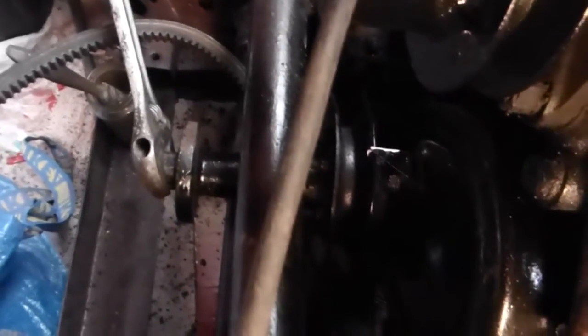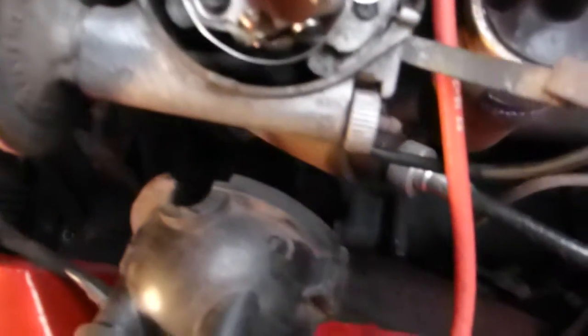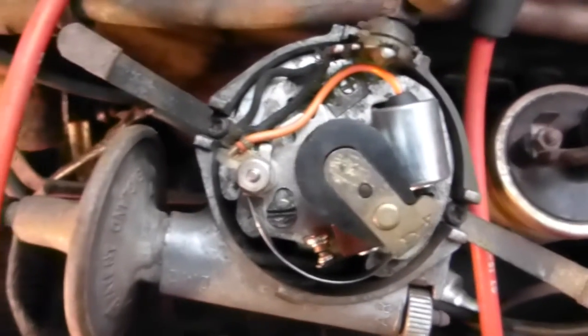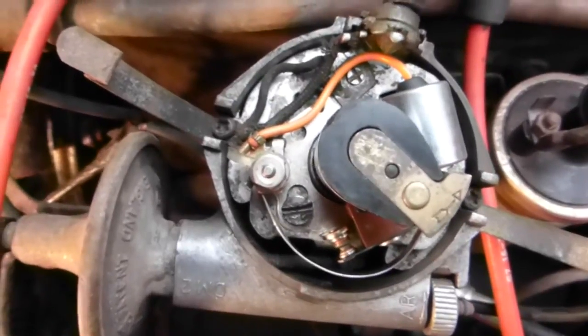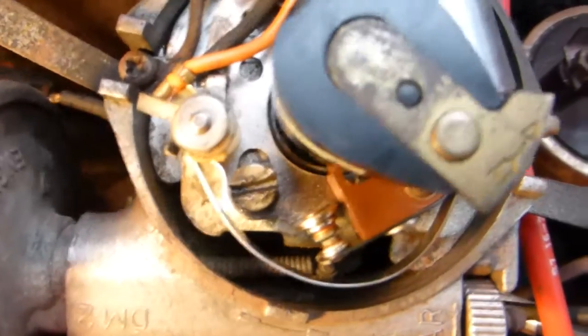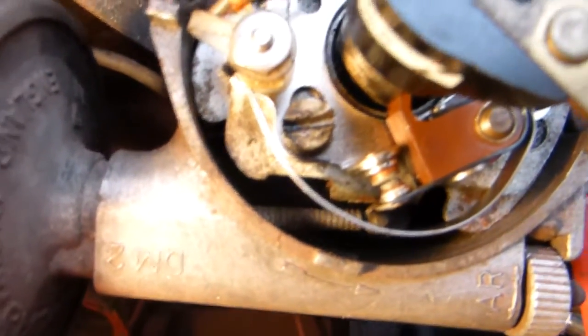You can see down there that the white marks I put on the pulley are at top dead centre, but when you look across at the distributor it's pointing away — it should be over this side pointing towards number one. So I know that is top dead centre but on the exhaust stroke, so I've got to rotate the whole thing and bring it to the right position and then check. You should see that with it in the wrong position the points are wide open, so it won't fire.